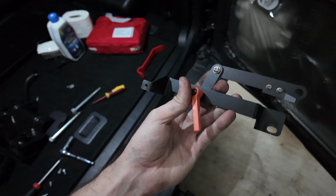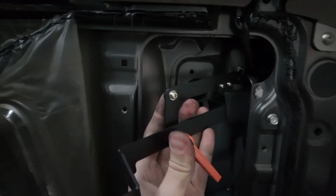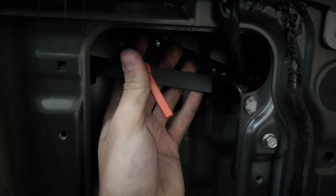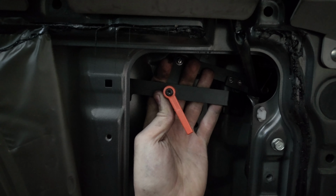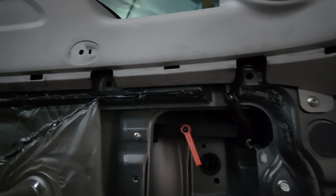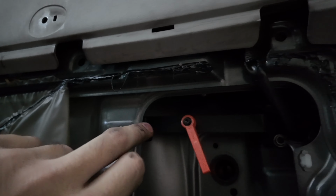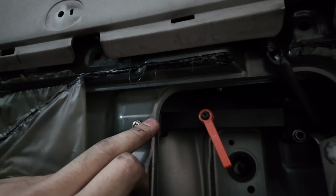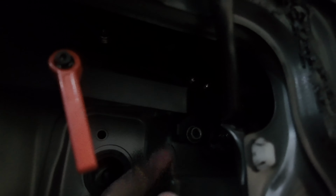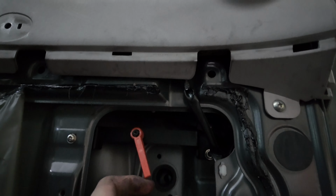So this is the rear door opener. So essentially how it's gonna fit, it will go in here. It's gonna sit something like that there. Awesome. So I'm just quickly gonna fit it up and I'll show you what it looks like. So that is all fitted up. So make sure that's where it goes. One bolt there, one washer will go behind there. There's a total of three supplied in the kit, and the other two will go behind that bolt and behind the mechanism as well, just so it's evenly spaced out, guys, and everything will work nicely.